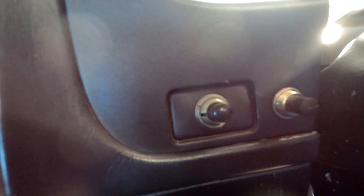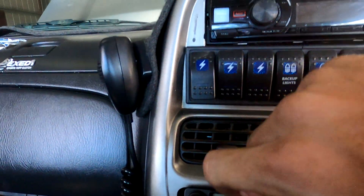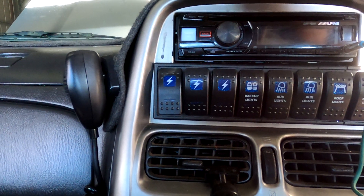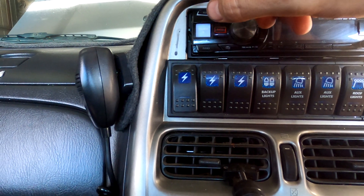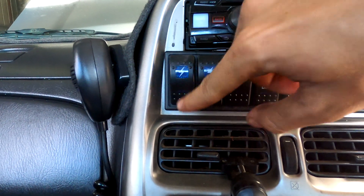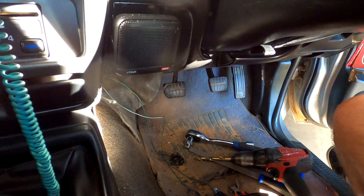Alright guys, so we've got the switch in — starter solenoid and glow plug. If you're putting it in this position here, just watch out: there's a support behind there that you'll have to dremel out or cut a hole in to fit the back end of this switch in. As you can see, they're pretty ordinary looking — not big panellist switches, they look pretty OEM, which is nice. If you switch it on and leave it on, it's not going to stay on forever. It's going to stay on as long as the car would have left the glow plugs on. With this switch you push it on, hold it on as long as you want, then take it off. That easy.